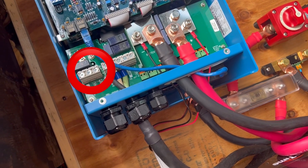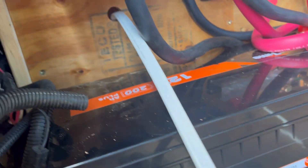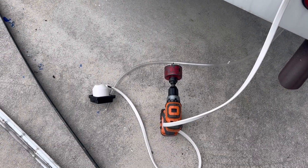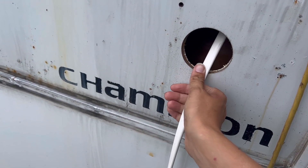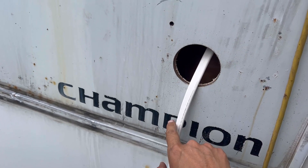This is my MultiPlus. The left three terminals will go to the shore power inlet. That's what this white cord is doing here. It goes back through this wall and out through this hole that I just drilled. But that is my shore power inlet. So now I just feed this wire up through here and attach the inlet to the side of the bus.